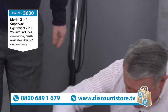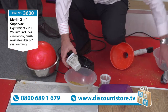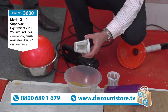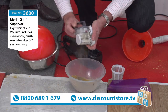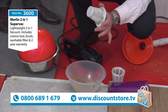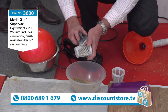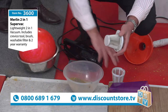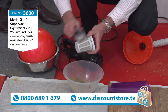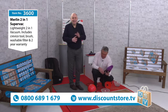You also get what we call a double HEPA filter. Basically, the air that comes out is cleaning the air — it takes out all the particles. It's a lifetime filter, meaning it should last the lifetime of the vacuum. However, if it doesn't, they're about five pounds on our website. All you do is just brush it — it is a double HEPA filter, you can wash it, but if you do wash it make sure it's 100% dry before putting it back. I always say just brush it. That clicks back on and you've got your vacuum back in two minutes.